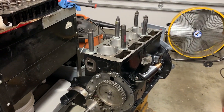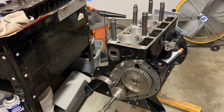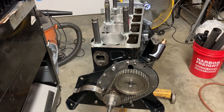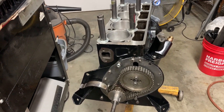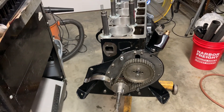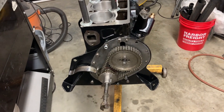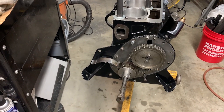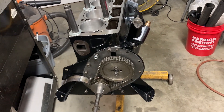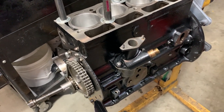All right Dad, good morning — Sunday morning. I thought I'd give you a little bit of an update. I had my buddy Nick come over on Friday and we spent pretty much the whole day timing up the camshaft, but we finally got it. It's close to 110 degrees, but just not quite — it's a little advanced, which is a little preferable. We could just never get it to go bang on. We've got that set, and last night I got the distributor pedestal set.